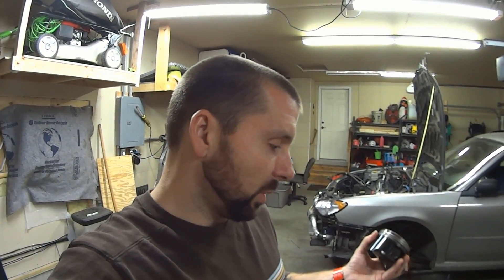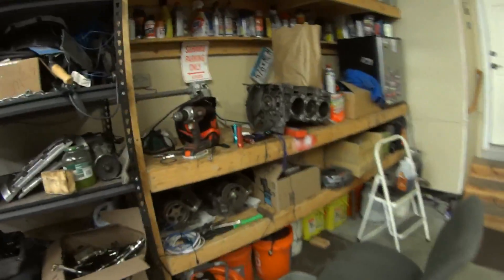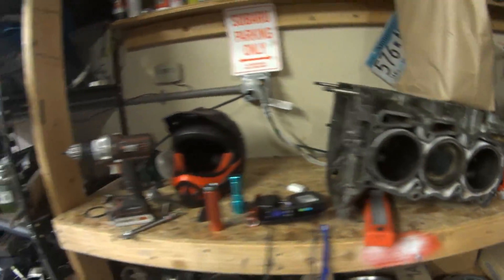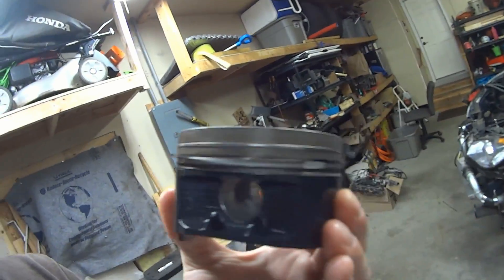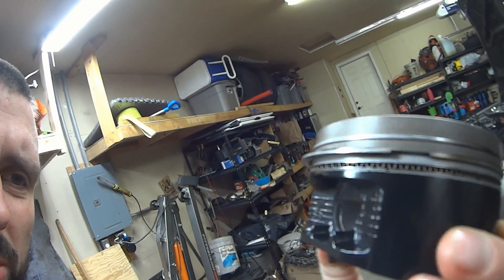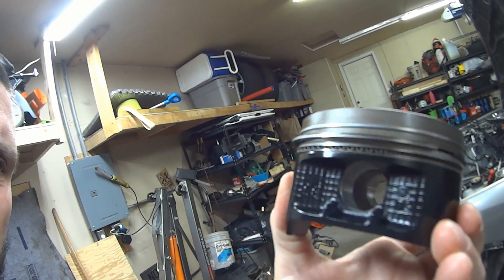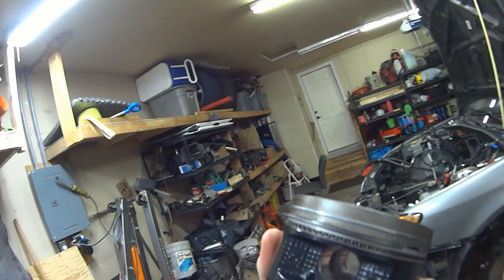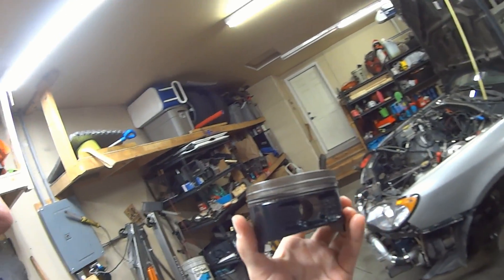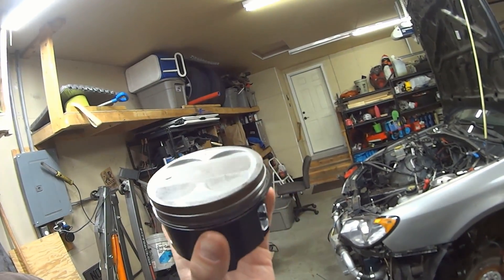What I've done is I've taken a piston out of my old short block which is right over here. We pulled one of those out and I actually took a few tries to find one that I liked. But once I did find one that I liked, I basically just sent it off to have it moly coated, just like all my other pistons. This can prevent wear from the side skirts. Any wear that was already there, this will alleviate that - is the idea. And hopefully negate any piston slap. I didn't have any with any of the other pistons in the short block, so figured might as well have the same thing done here. I could have just thrown it in, but why have one different? That's my theory.